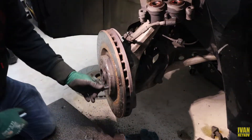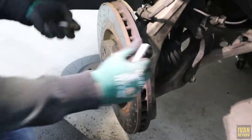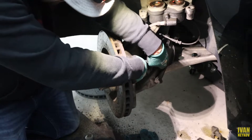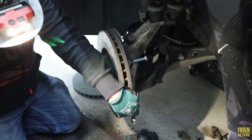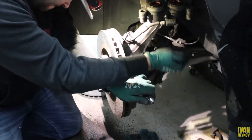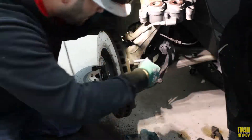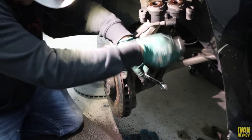The hammer wasn't working, so I went to the store and got a half-inch bolt, four inches long, with a washer and a nut. Right here in the back, between where the brake caliper attaches, you slide this bolt in, then get the washer and the nut. Then use a three-quarter socket on the front and another three-quarter on the very back end and tighten it.